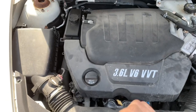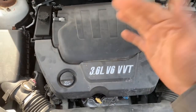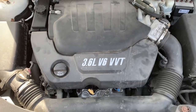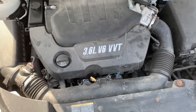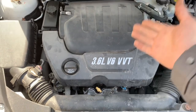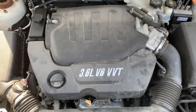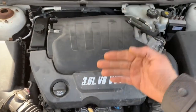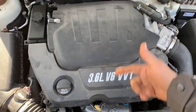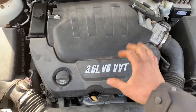That doesn't tell us if our cat is specifically bad, but it tells us if our exhaust is bad. If that's the case — if our needle moves at all — we'll start disassembling the exhaust to figure out which component exactly has the blockage. At least this will tell us if our system has any blockage whatsoever, whether it's a bad cat or something else. Now if you're dealing with a six-cylinder version like I am right here, you'd have to do it on both banks before the catalytic converter, working our way away from the engine. If we check right here and it's bad, then we check right there and it's bad — maybe we've got two bad cats, or maybe we don't. Then we'll separate the exhaust.